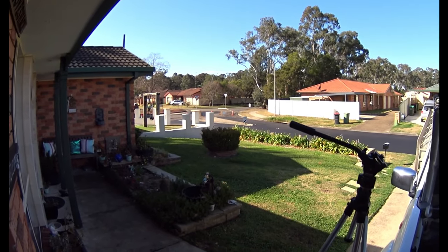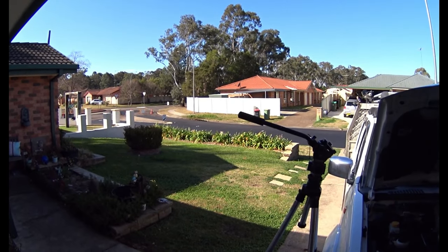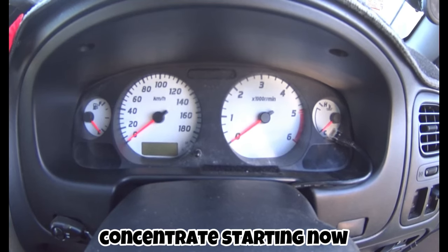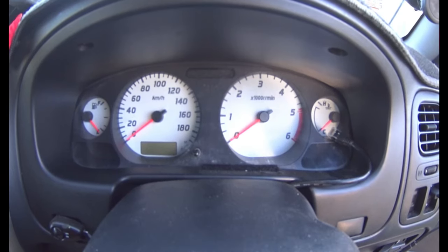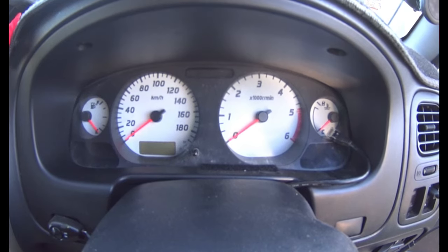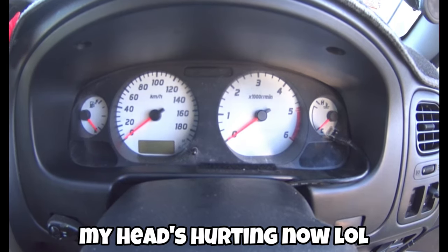They cut about 200mm down and cut all the road up so we had to get out before the trucks got in. Also, an alternative ECU reset sequence I found: ignition to position one, count to three, then depress and release the accelerator pedal five times hard and fast, count to ten, fully depress the accelerator pedal, while it's down count to twelve - the engine light should start blinking - release the pedal, count to ten, push it in again, count to ten, let your foot off, turn off the ignition, then start your engine.